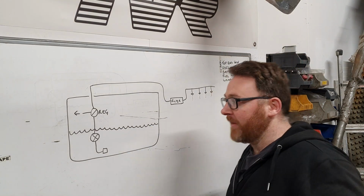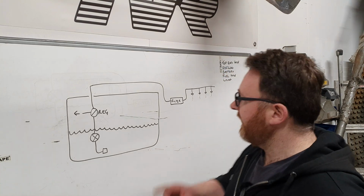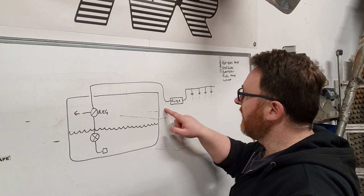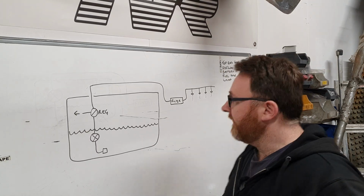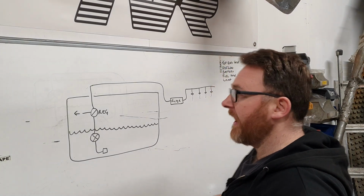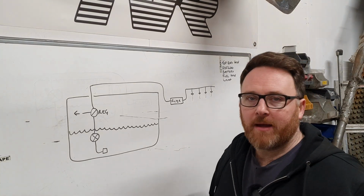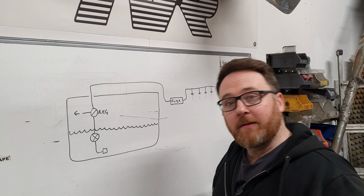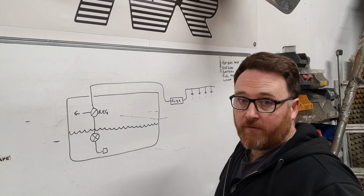That was why. So the next iteration we're going to have an adjustable fuel pressure regulator involved in this, but I'm still going to keep this returnless system. The reason being this section here. Remember, I've got a really tight transmission tunnel and I've run one fuel line in already. For me to put another line back and have it safe looking for the IVA, I'm going to need to repeat all that process. And I'm pretty tight in space as it is. If I can just keep that one line for the moment, it's going to do me a lot of favours.